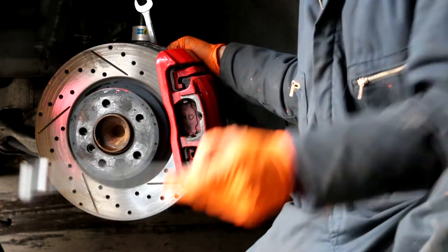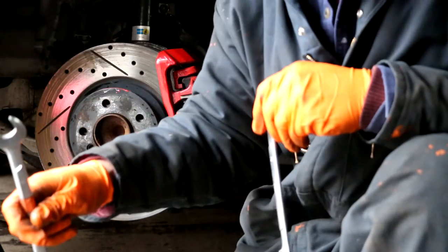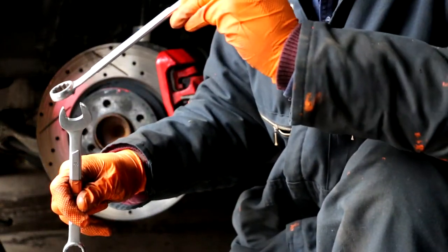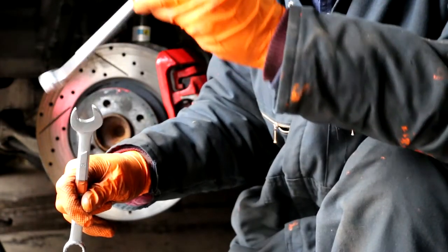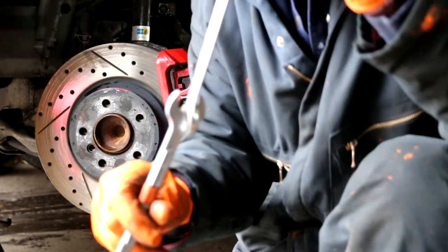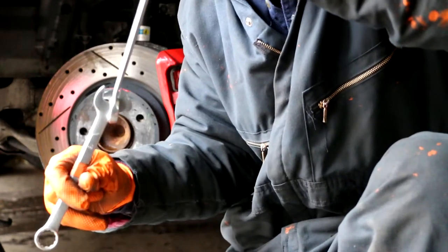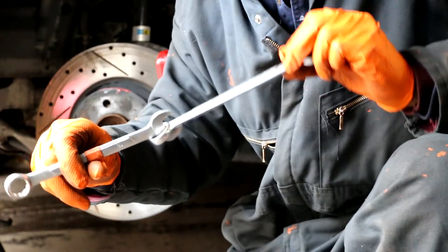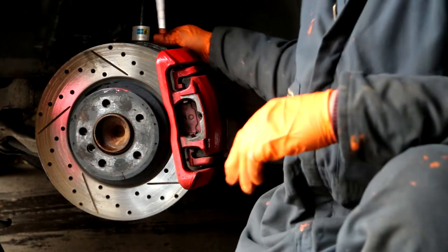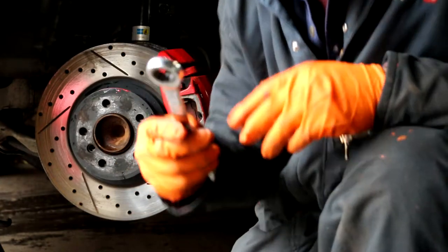This is where the 19mm wrench comes into play. I use it as leverage. So I'm going to show you how this works. If I'm loosening this way, you're going to take your other wrench and stick it on there, like this. Can you guys see that? What this does is give you an extension to lever the wrench to apply more force, if that makes sense. And then once you crack it loose, you can switch over to your speed wrench, the 18mm with the gear inside.